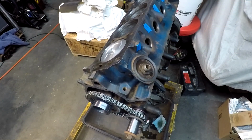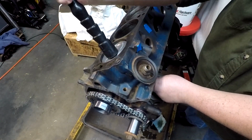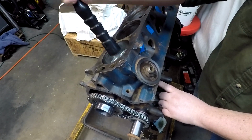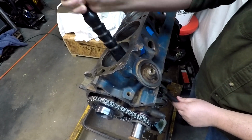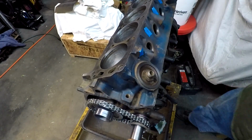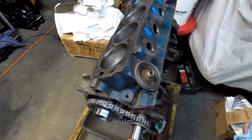Alright, now we'll take said hammer again, and looks like we're mostly straight. Give it a slight twist as we're coming down. Let's keep tapping away till we get closer to where we need to be. There we go. She is now set down on the crank. Pull off our little pieces of hose. Looks like the bearing is right where it should be. Didn't move out of place.